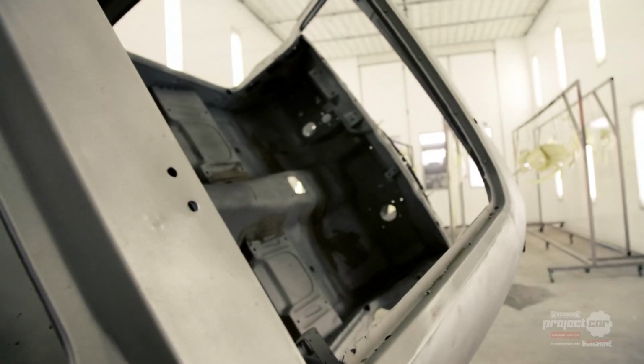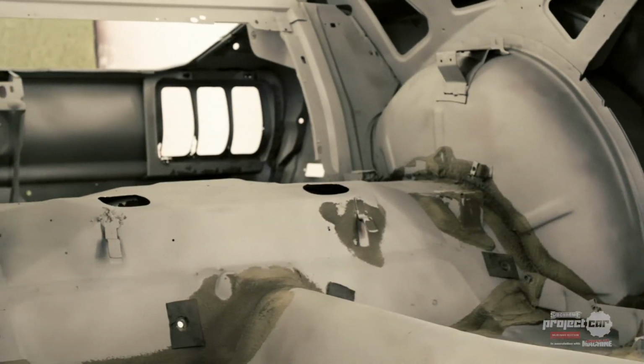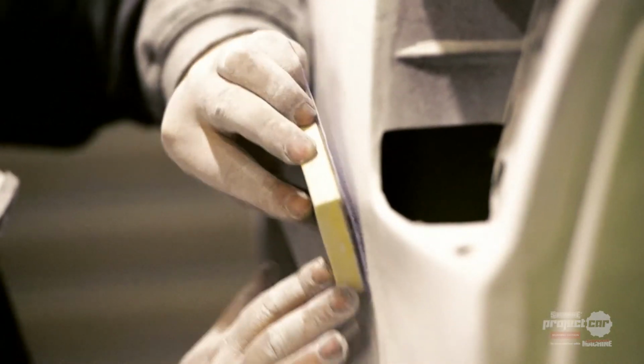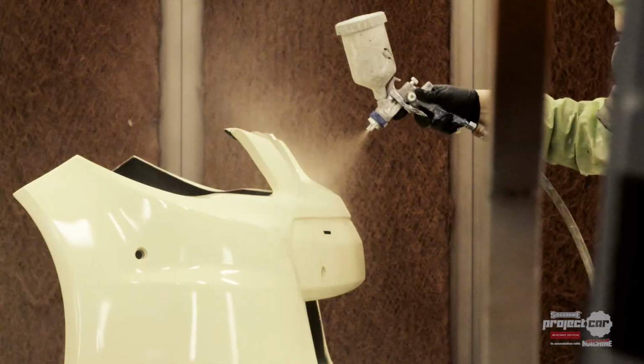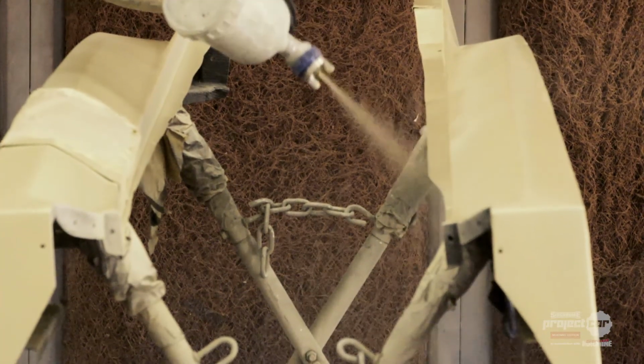No, it's not. So some of the glues, some of the body sealer that goes underneath, simple things like decaling can be a real problem to get off. So it's the old manual process is probably the best way. Yep. Before and after, we will blast 2 coats of epoxy primer in every crevice we can get to. Then that enables everybody to handle it and do the repairs and all the things that are necessary through the rest of the project. Awesome. Well, let's get some paint on this thing.